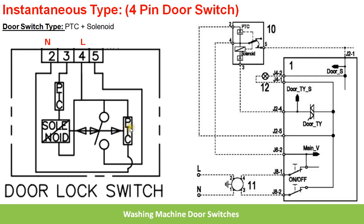Here, if you observe, there is one more PTC with a bimetallic strip which acts as a heater. This comes into picture whenever incoming power fails to the washing machine. During that time, the impulse pulses will not be applied to the switch, so it will not be instantaneously unlocked. Whenever the power fails, this switch also takes around two minutes for the door to unlock, because there is a bimetallic strip which takes around two minutes to cool down. This is how this switch operates.